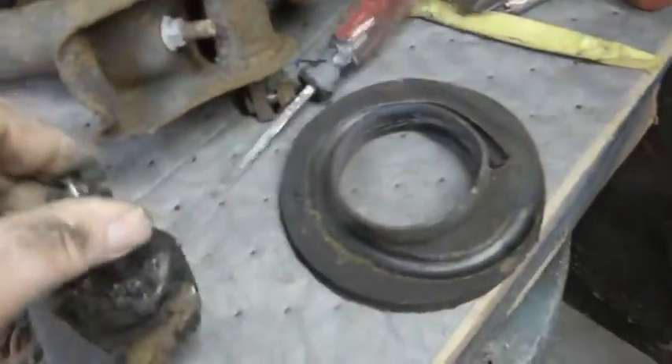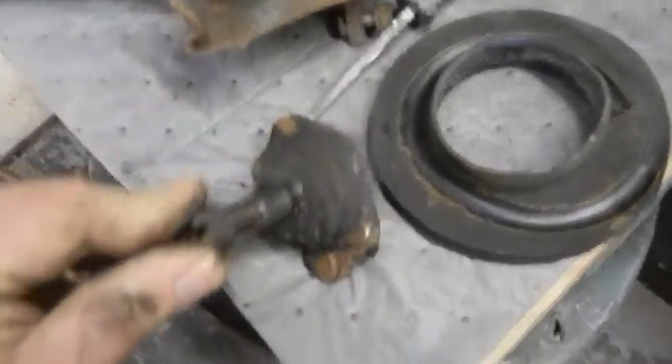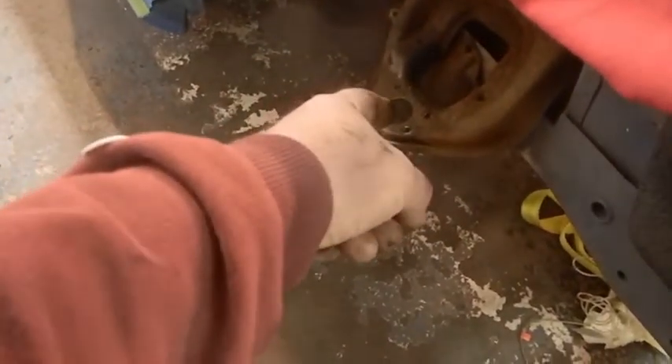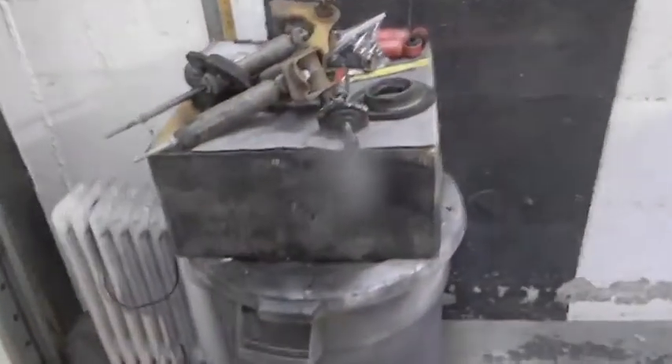We didn't do a lot today but we did what we had to do. The two ball joints - I'm really not into touching these things without my gloves on, my hands are dirty enough. The resistance I feel is just a boot - the boots are wasted. There was no up and down movement in these but they were definitely loose. All the load is on these: the load comes when the car's on the ground, from the top through the upper control arm, and the tire wants to kick out or kick in - it puts a side load on that ball joint big time. The bottom one just keeps the arm from doing its thing - it just pivots on it. The way they designed it, it's a ball and socket but the cup pushes on top of the ball to keep them compressed.